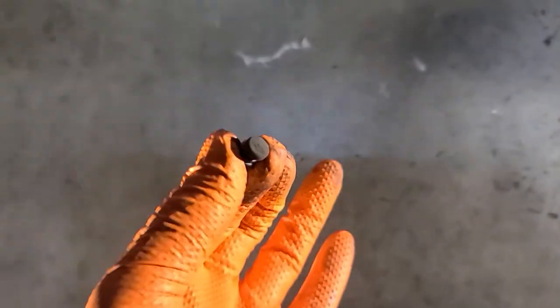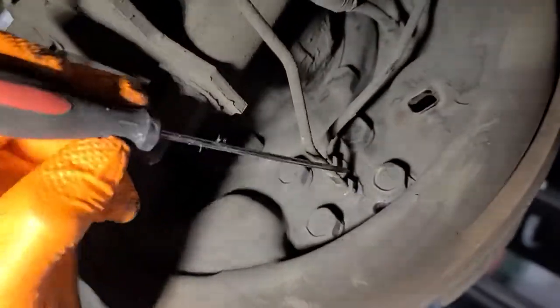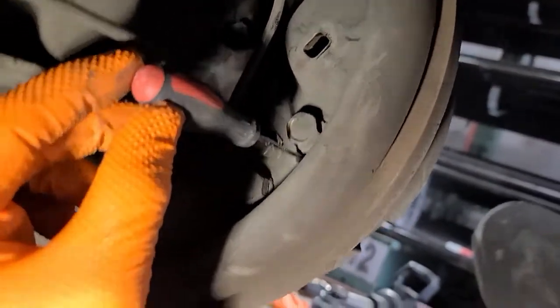The little trick to these drums is on the back side. There is a little tiny grommet — this is your culprit you want to look for. There are two sets. Right there, you pop that grommet out. The best way I'd suggest — that I've been having luck with — is a small Phillips screwdriver. If you push it perfectly in, it will catch that little clip that holds the thing.